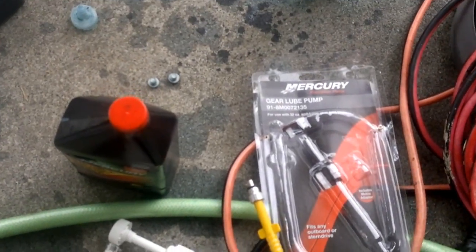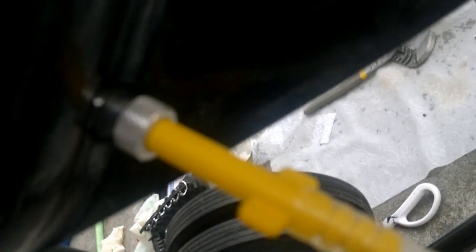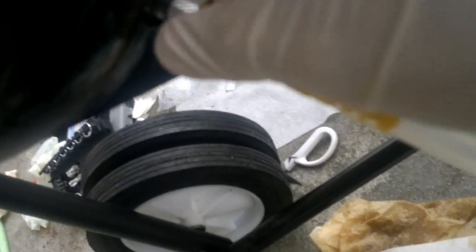Okay, as you can see I have fitted the bottle. Top of the pump goes in, and there's my little adapter. The yellow adapter is the US Imperial, and the metric adapter is for international mercury outboards and Canadian ones. This little metal thing just slides in, and you can see it basically just gets screwed into the bottom of the mercury outboard. I've kept the top hole open as mercury recommends.